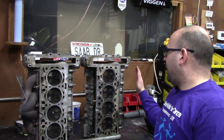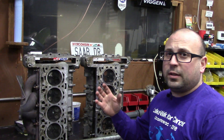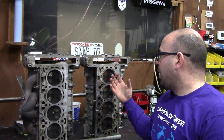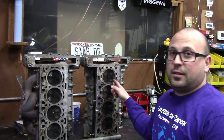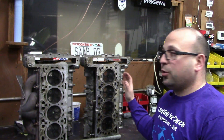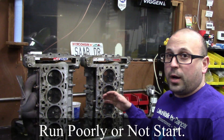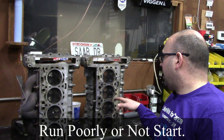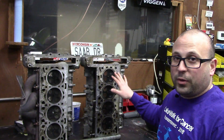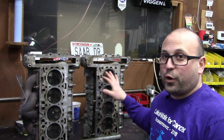What happens is the intake valves actually wear down on the edges. They were made of a soft material, and over time they wear down to the point where they don't actually seal correctly anymore, and then you start getting low compression, which in cold weather or on the first start of the day will actually make the car run poorly. Let's get in here and take a look at these valves, and I'll explain what happened to each car these heads came from — they had two similar yet different failures.